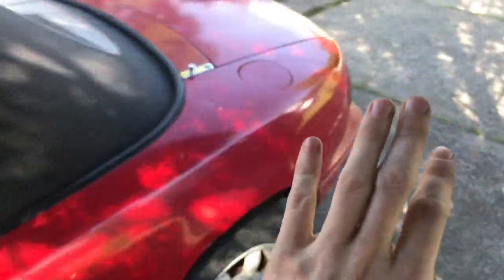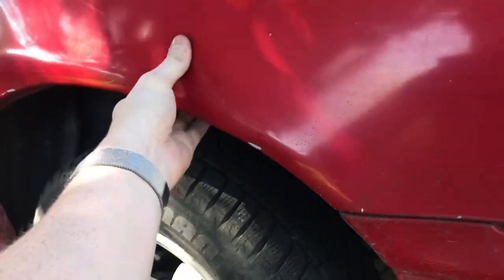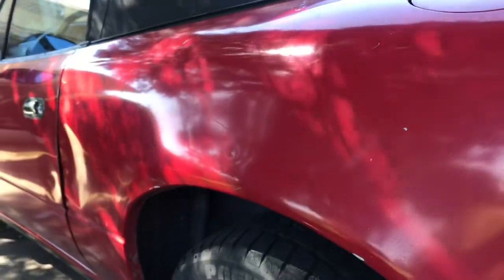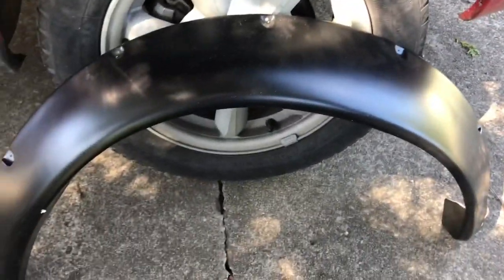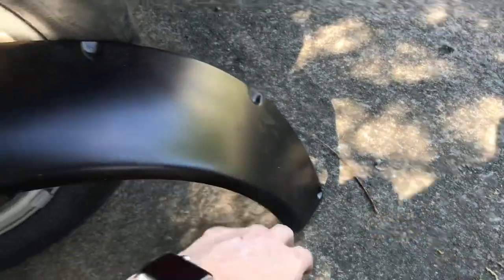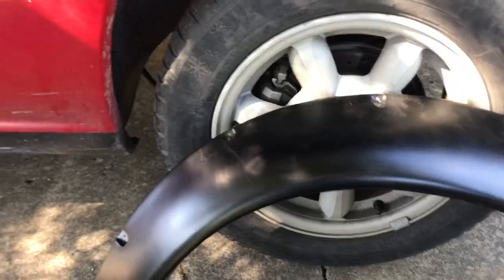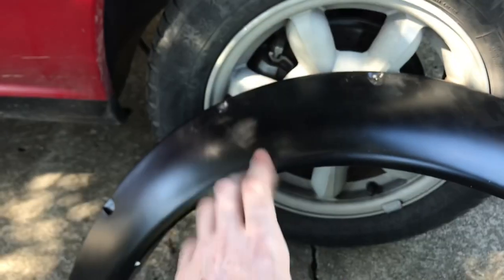Now I need to start on the back ones. The back ones are going to be a little bit different. From what I have seen, it looks like we're going to cut so much up here that it's going to start to interfere with not only the quarter panel, but there's some sheet metal welded to the back of this, and we might have to eventually weld in a strip in there to seal it up. The back ones have this piece in the back of them and a thing in the front of them — that is going to be how you determine which side it goes on. You can also see it's a lot wider in the back than it is in the front; it kind of narrows out. It's pretty clear how the front ones go on, but the back ones are a little less clear as to where they go.